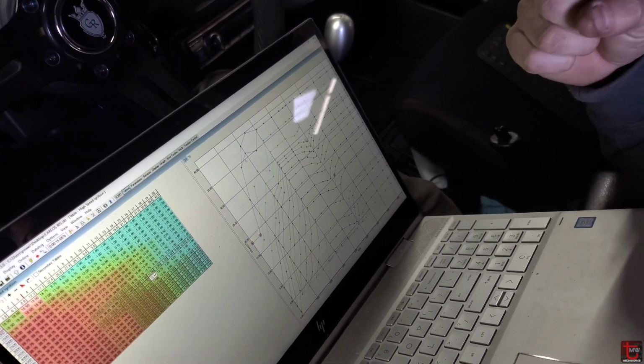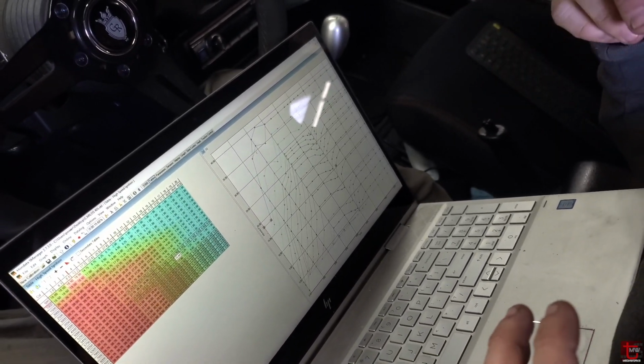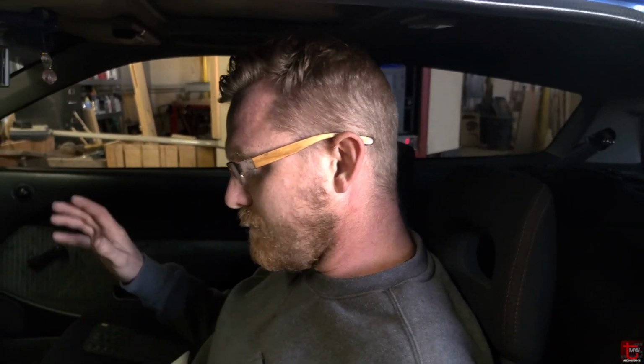We have stock sleeves, and we have too small of an injector, and we're not trying to get every last bit, right? Trying to keep it safe, so down the road we can do major power here. So it's important to note where your peak torque happens once you've changed a bunch of parts on the motor, because peak torque is going to happen at a very different spot. If you start with a stock tune, that timing depression that's naturally there for every car may not be in the right place. So you want to make sure your depression is in the right spot, which will make the car safer. And if you have it in the wrong spot, it can cost you power that you don't need to be throwing away.